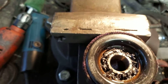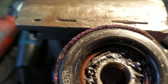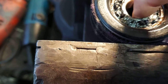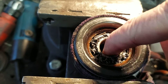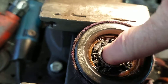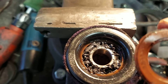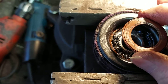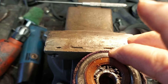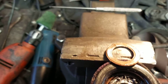I did the greasing and oiling as best I could: oil under it, degrease it, oil again, take my finger, and turn the race a little bit. You can see it doesn't take much to do it — just work it in a bit and put this back in. So here we go, I'm going to wipe the seal off, turn the camera back around, and let's get this thing back together and back on the car.